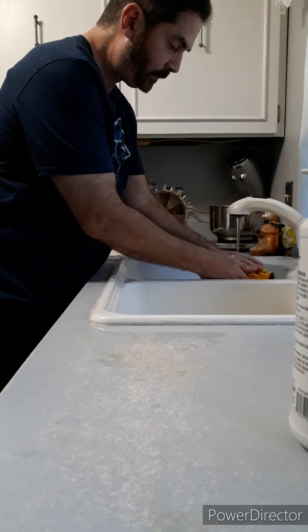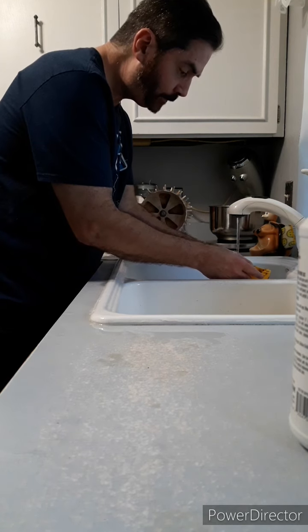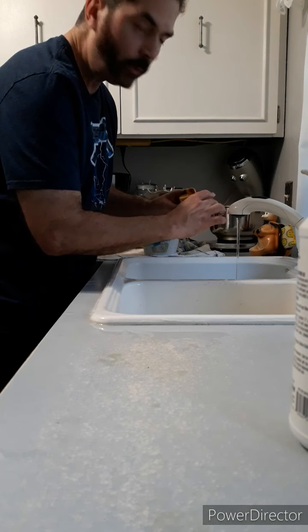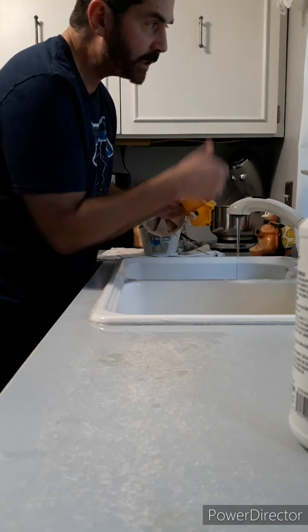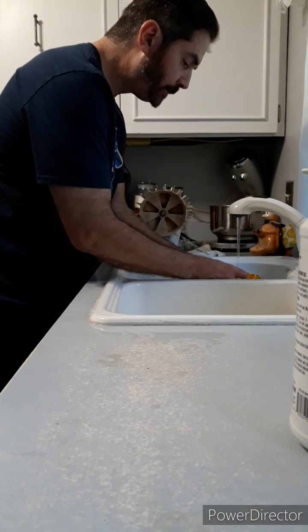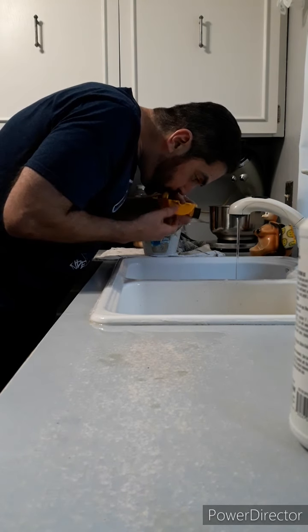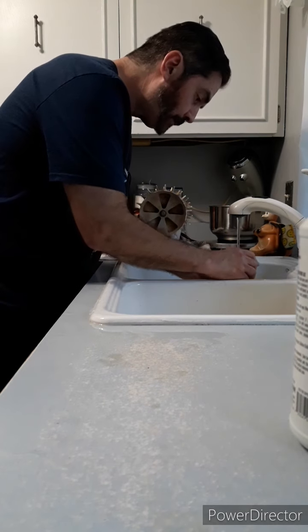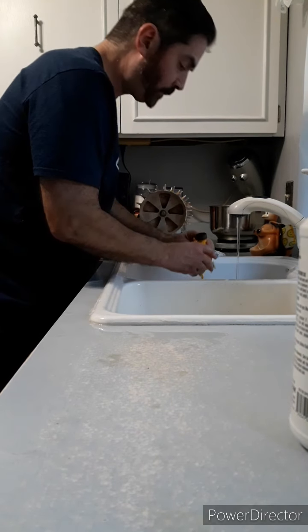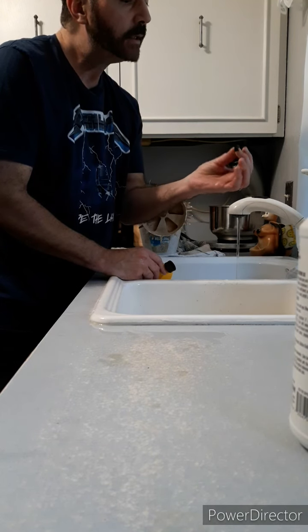There it went. This here is the plunger. This is what triggers the stop device when it gets pressed in - so you can leave this thing running. As long as you have the ramp with the stop device on there, it'll turn itself off. Make sure this is free and working well. Make sure all of your clog is out of there. It sounds good. That's what was in there - a lot of dirt and some hair. That will have a dampening effect on the performance of this device.